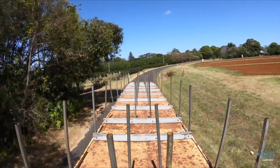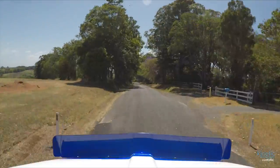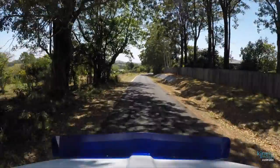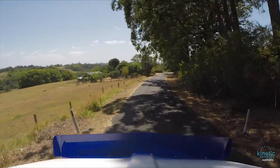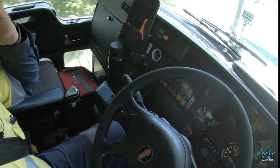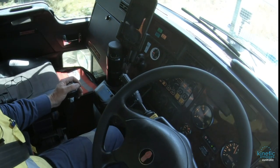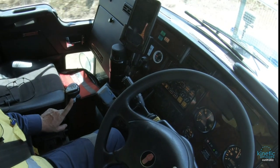I've got no load on, but I'm going to simulate because this road is quite hilly and tight. I'm going to have to slow down for some corners to make sure my trailer doesn't cross the road too much — there's not a lot of room for other people, especially a semi-trailer. So I've got the engine brakes on, we're in the split position, and I'm going to go down a gear in the split position. It really is quite easy — don't be afraid of the split gear, that's the only thing that makes an 18-speed an 18-speed. It is the ability to split each gear.